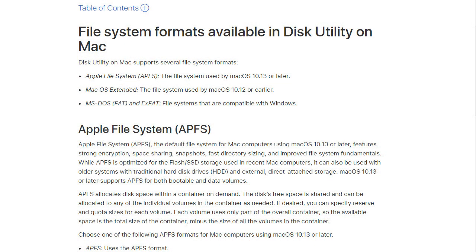So make an image copy. If you're using Time Machine, that's good too, but I would do both. I've had enough bad experiences with Time Machine that it's probably better to also have a direct image copy of your internal drive. Before you install Big Sur, disconnect your Time Machine drive, your external drive, and any backups — disconnect all USB devices you don't need. One of the things the upgrade is probably going to do is attempt to upgrade your Time Machine disk to the new Apple file system, APFS. Time Machine until Big Sur was an HFS Plus disk; they're now making it an APFS disk, but that's a risky process. Unplug the Time Machine before you do the Big Sur upgrade.